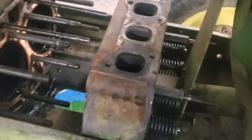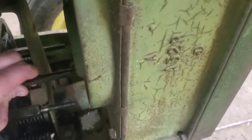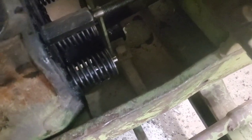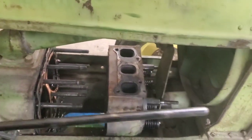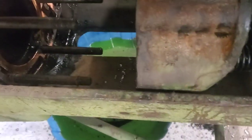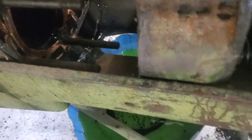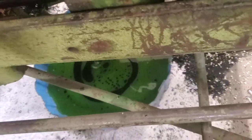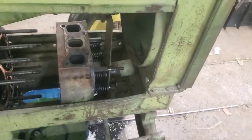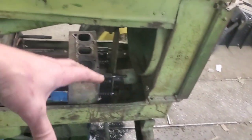With the head slid forward now you can see how we can get these inner push rods to come out of here. Just to make sure you put them back in before you reassemble - and your head gasket: this was a new one but not anymore, so we'll have to get another one. These are pretty readily available. Now we're going to snake the head out of here, slide it back a little bit, and it kind of finagles out on this side.